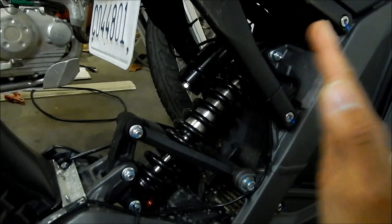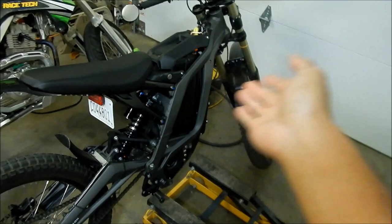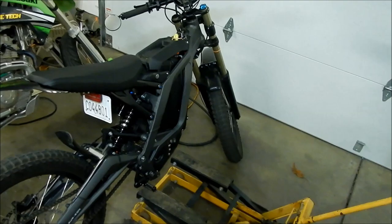The bike's geometry will be proper when the sag is correct. If it sags too much in the rear, your handling will be lazy and it won't want to turn. If there's too much preload in the rear, you lose rake and the bike becomes less stable. That's another reason you want to set the preload properly — it made a world of difference on my other bike.